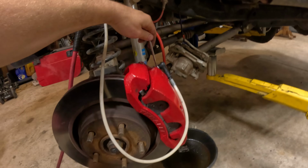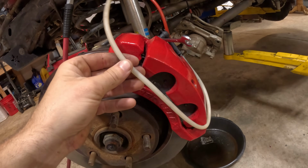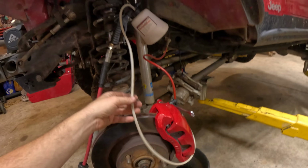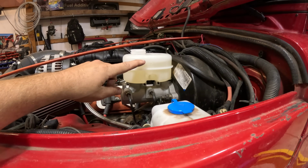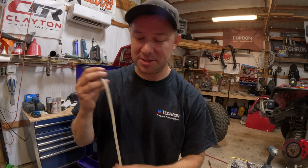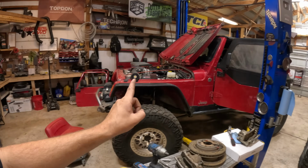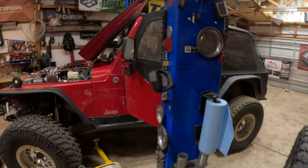So one of the only downsides is that you really can't see the bubbles, but you can almost kind of feel it. And realistically, it's pulling it through. I'll just let it run down a little bit more. It should be good. Now, it's still nice sometimes to follow up with somebody pressing the pedal and putting some pressure behind it.